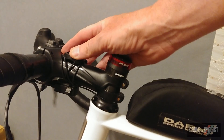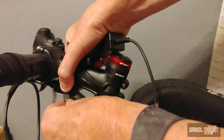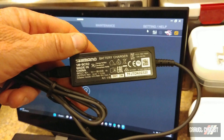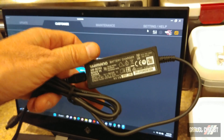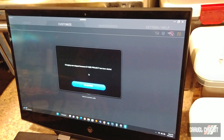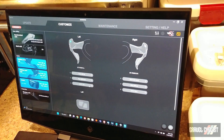If you don't have a bike with any kind of Bluetooth connectivity, you have to use your junction box charging port. Here's the charger — you can connect this to your laptop, run the e-tube software and configure your shifting. Important note: if you have the older charger for your Di2 system, the SM-BCR2, you'll have to use version 4.04 or earlier of e-tube. Plug into your laptop — and there you go, everything's connected. From here you can customize everything just like we did with the phone.